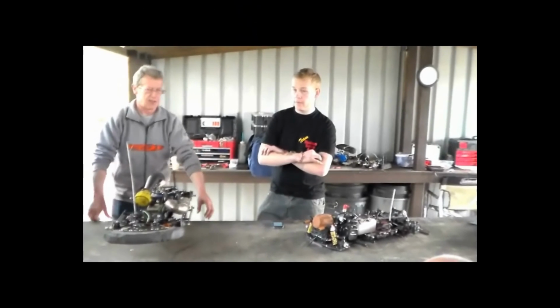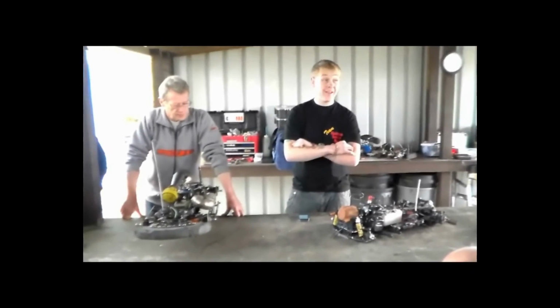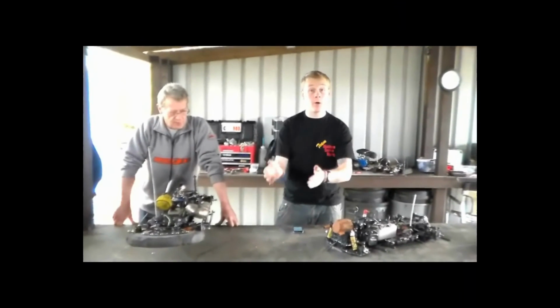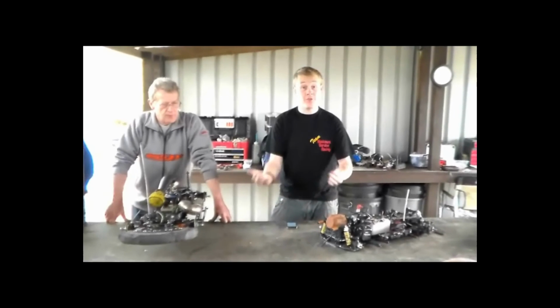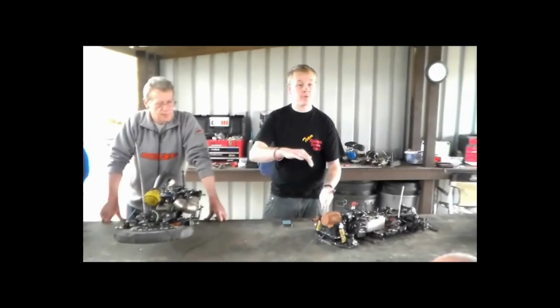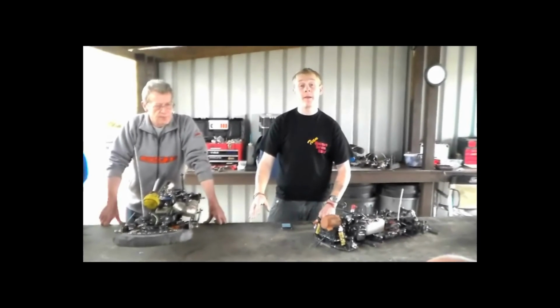The biggest effect for a rear roll bar isn't going into an initial corner. It's when you go from one corner to the next, as in a chicane or a set of corners, or where you have to jolt from left to right into that corner. That's the biggest effect a rear roll bar makes.